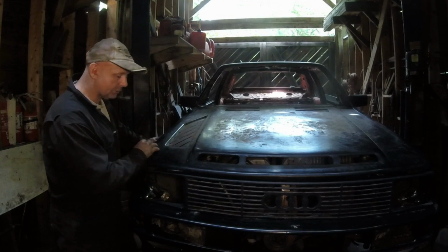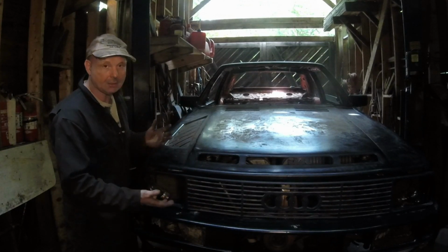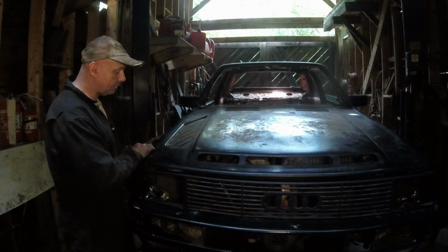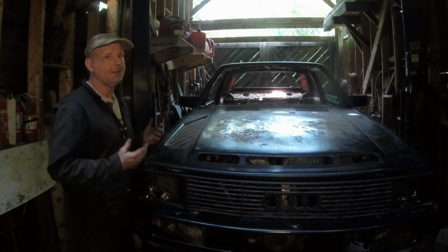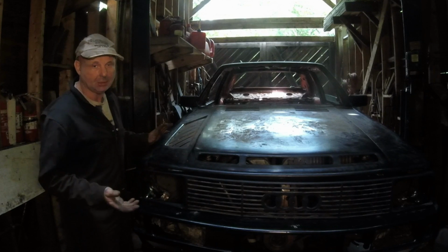Okay, now, fenders were all set. Bumper, hood, grill, that's all set. Last thing, big thing, headlamps. Headlamps are in direct relationship with how they look with the grill. Does it matter to have the fenders on? No. Bumper, hood, no. None of that matters. It matters that the grill is on and in place. Now, the only way to reach the brackets or to weld the brackets on is to pull the fender off, which I'm going to do.